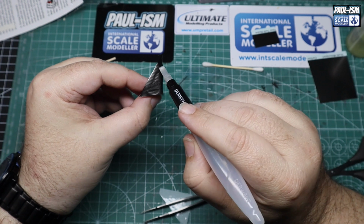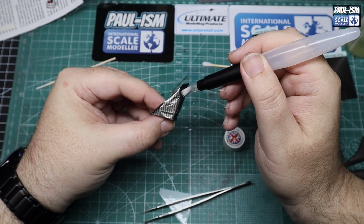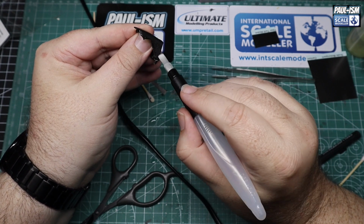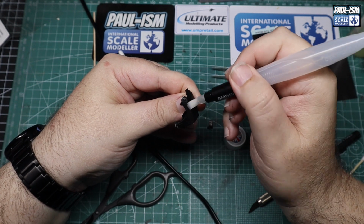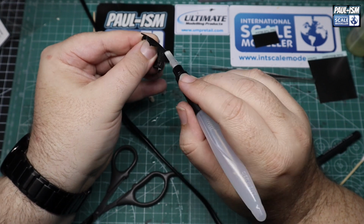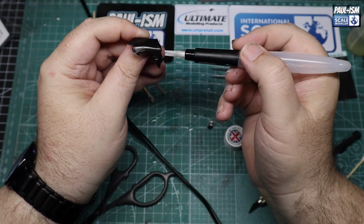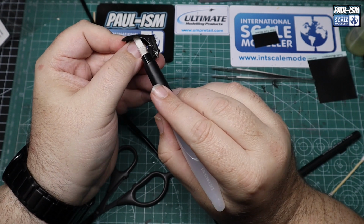As you see, we've got a natural seam on the back of the seat, and that's where I'm going to cut it. And then if we piece it and you line up the weave, it's kind of an invisible join. So a little bit of heat on there, and as you can see, it started to conform lovely. I did it off camera, but there was a heat gun applied. And then we got our UMP strong on the brush again, and just give it a little brush and start to persuade it into corners and what have you. Like so. And it starts to conform beautifully around all the edges.